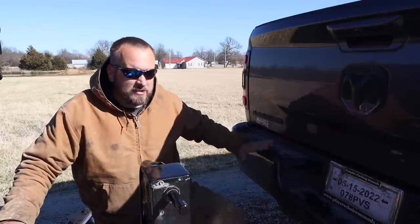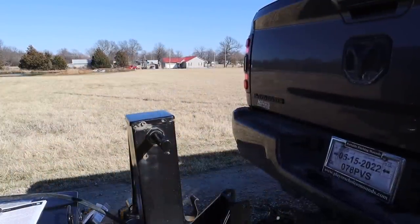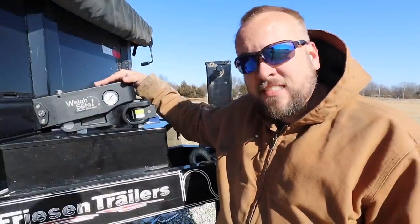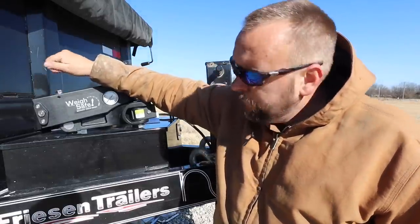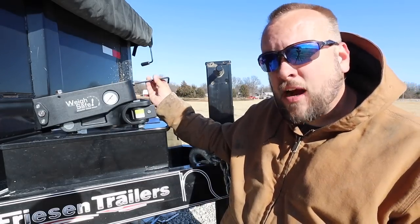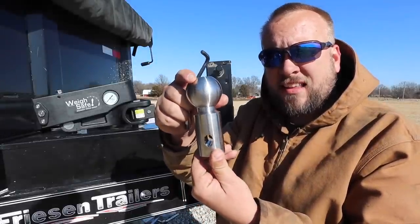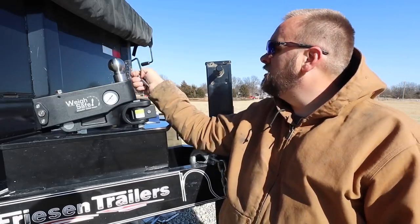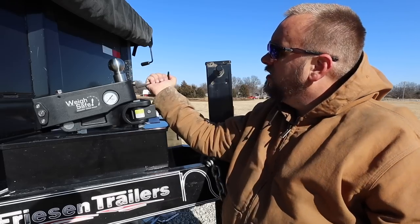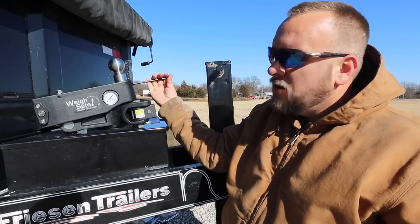Right now, it's a matter of unhooking this, pulling the truck forward, and setting the trailer up on its own. Now, this is the actual head unit — your gauge telling you how much pin weight you have and how much adjusted weight you have. Here's your adjustment knob. Step one is to remove this pin right here and insert the ball. I've got the 2-inch and the 2-5/16ths balls, so you can switch them out. Let's put that in here and tighten this all the way down. It says 30 pounds torque, but we're going to get her good and snug.